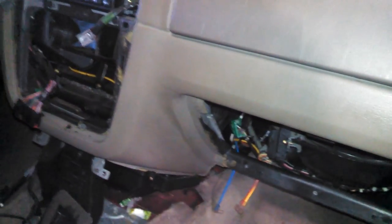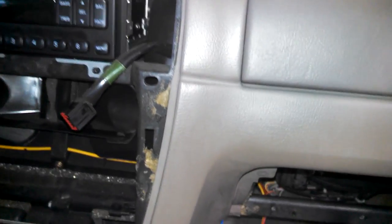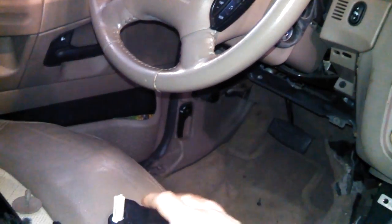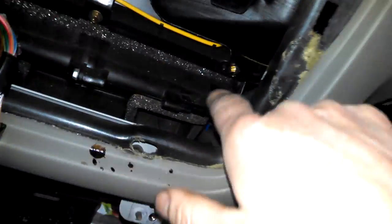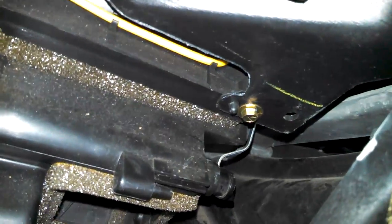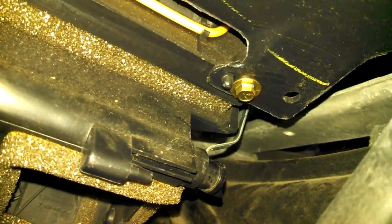So we're inside a 2003 Ford Explorer, doing the right side passenger side temperature blend door actuator right here. It says it's about 6 hours to pull the dash and replace this part, which is down in here. This is actually where we're taking it out, right down in here. And the real problem is the stupid actuator. You can see a little silver bar down there. Vacuum operated actuator